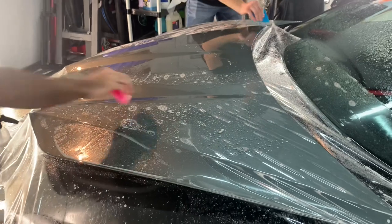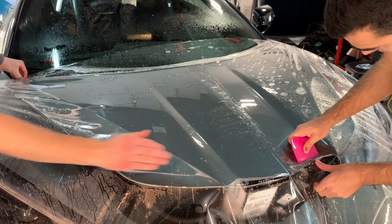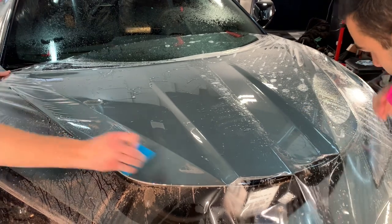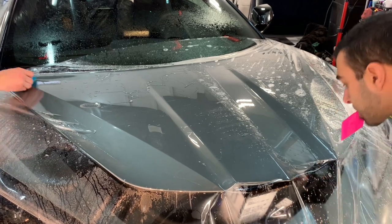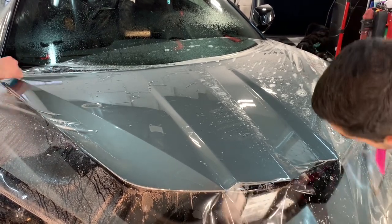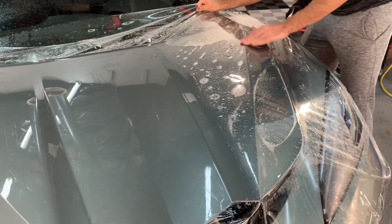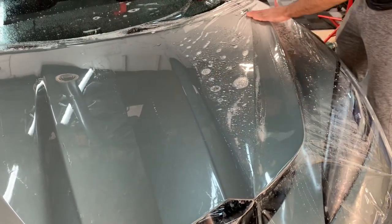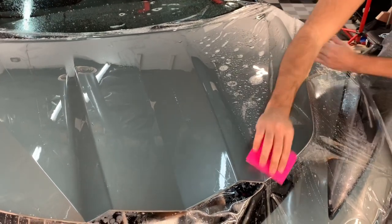We have the hood prepped and we have a little bit of a 60-inch roll left over, so we're going to do a bulk application to the hood. That means we cut a sizable sheet right off the roll and lay it down on the hood, then do our own custom cutting after we tack down the film. We'll use the excess instead of blowing up a pattern off the plotter, getting a nice custom cut — leaving an overlap of about a quarter to half inch to wrap around all of the edges and corners so the hood is completely covered with no lines whatsoever.